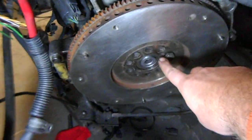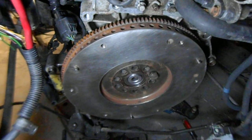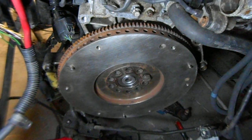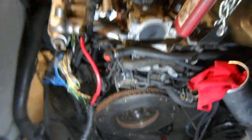This is my Volvo C70 convertible. Today I machined the pilot bearing that goes right there on the end of the crankshaft, and I put in my rear main seal. Tomorrow I'm going to bolt my flywheel in place and put some Loctite on those bolts, and then put the transmission back in and start putting everything back together.